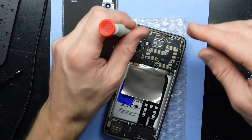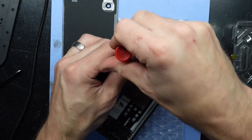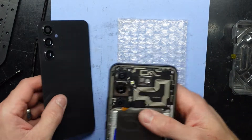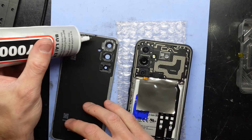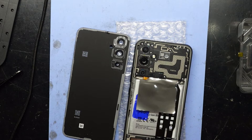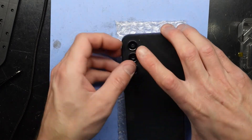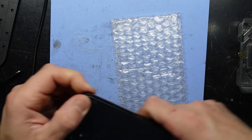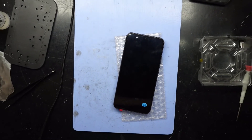All these screws are of the same length as well. All my screws are back into position and are good. I'll put a little bit of glue here — and I think that's about as much glue as I actually need to use. The rest of that seal is looking pretty schmick. Push that cover back on, work my way around. The phone's still fairly hot. Bingo! And from here we have one screen replaced on a Samsung Galaxy A54.